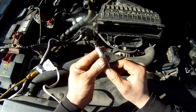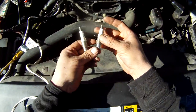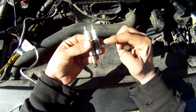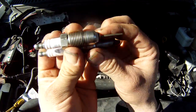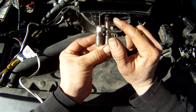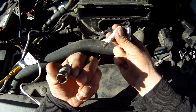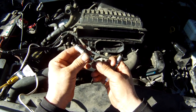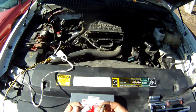The way the cylinder is laid out is completely different because of the three-valve setup, so it requires a completely different spark plug. What this plug is missing is the bottom sleeve part — it's a three-part spark plug. It has the ceramic and electrode, then a sleeve, then your threads, then your porcelain and electrode. There's not much holding it together other than some type of high-heat epoxy. The sleeve will spin out and you'll have to break it off, ultimately leaving a portion of the spark plug stuck inside the cylinder head.